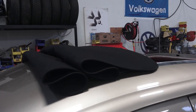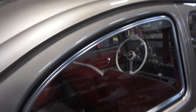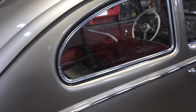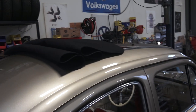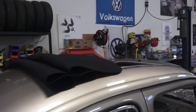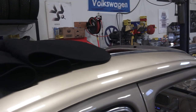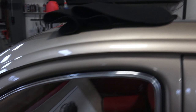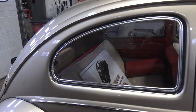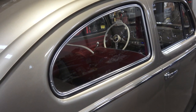The canvas material came from So Fine out of Colorado — love those guys. He also opted for pop-out windows in the back. I do recommend getting pop-out windows when you have a sunroof, because there is a helicopter thwomping effect on your ears if you have the sunroof pulled back without them. You could always open a vent window, but pop-out windows are really nice and a great addition.